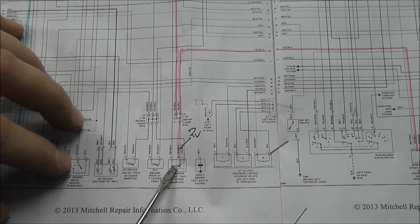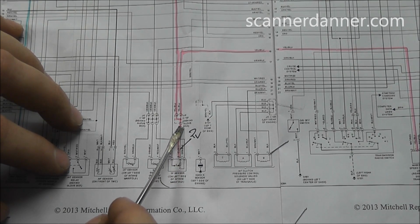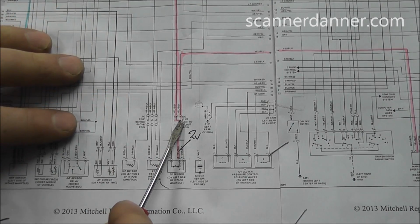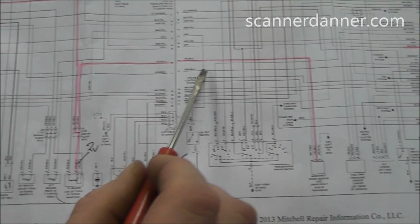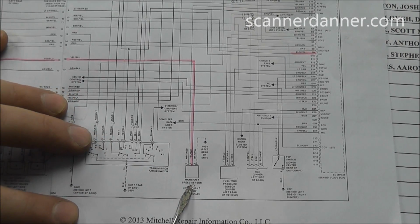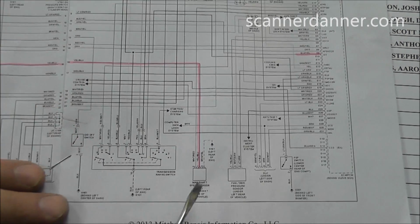The signal is on the wiper, and so we know that this wire is the signal wire, and that means that this final wire is the reference. And you see a splice here where we share this reference with another sensor. So mapping this out, you see it comes over here to my main shaft speed sensor, which would be part of the automatic transmission.